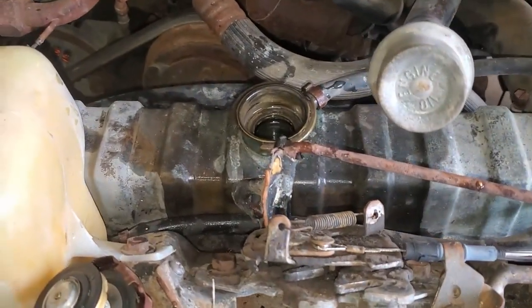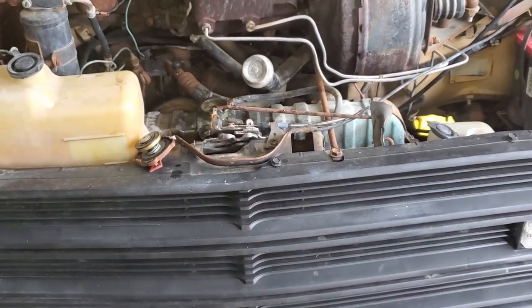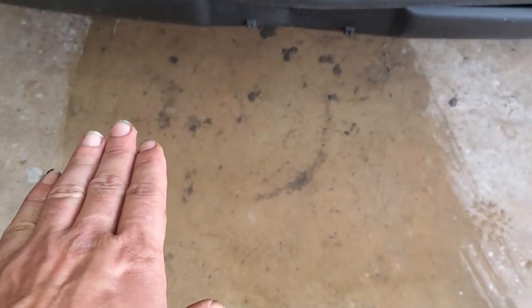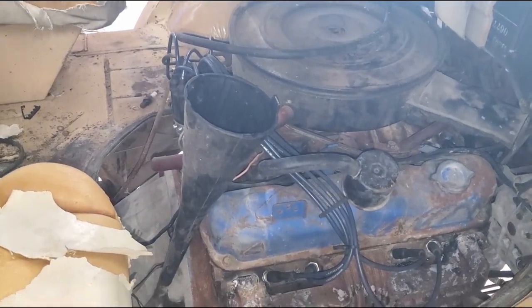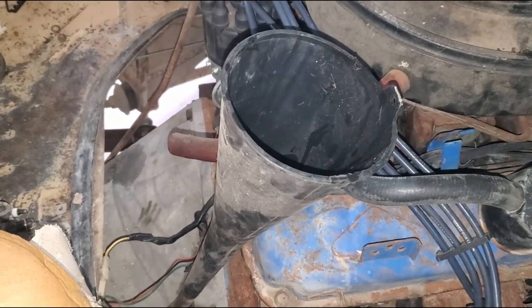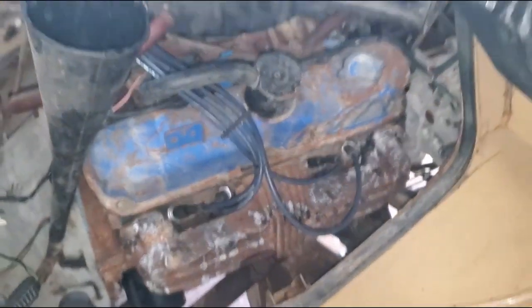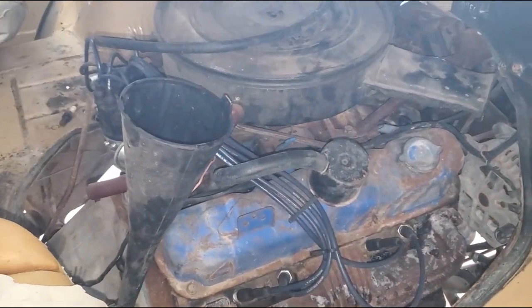As you can tell from the very wet concrete, I went ahead and topped off the radiator. We thought that radiator was empty - it took about a gallon, so that gives us hope that this cooling system actually holds fluid. I was all ready to dump tractor fluid in this thing, but the Dodge Whisperer did the right thing and got some automatic transmission fluid. We got that thing semi-topped off, still trying to figure out that electric dipstick. He's working his voodoo, getting this thing wired up to see if it bumps off.